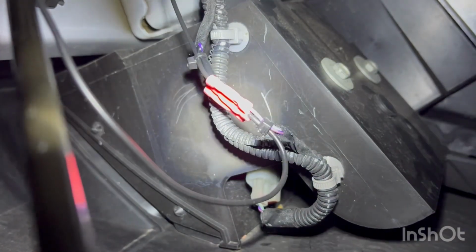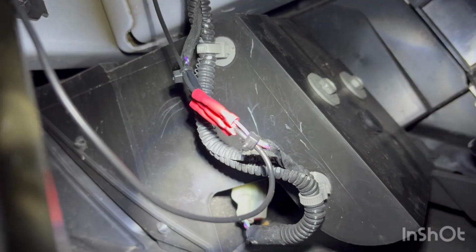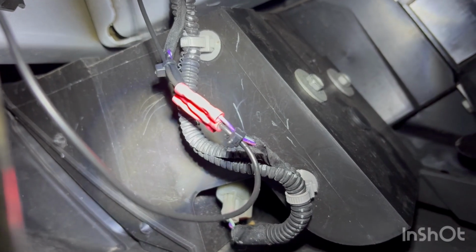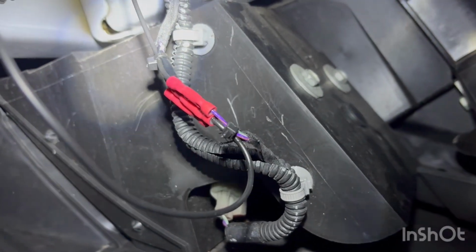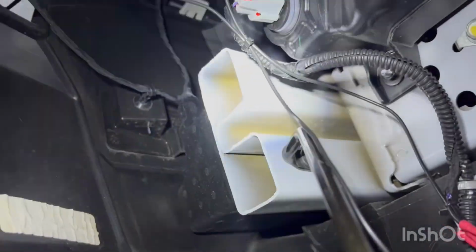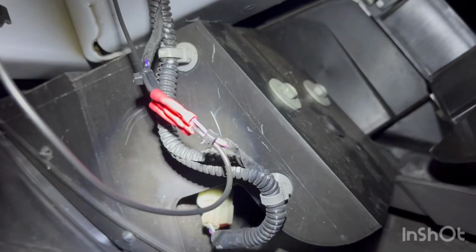I pulled the wires out of this plastic tubing here. I've got two wires running down from the top to the relay. I've cut the purple wire and am going to feed it through the relay. The other one accidentally got cut. I had to cut it to get that strong Teflon tape on there. It's pretty hard to get off the wires, actually. But anyway, I got the third splice in there for that. These wires are running up to the top of the front area, and I'm going to run them through the automotive relay. So I wanted you guys to see this.